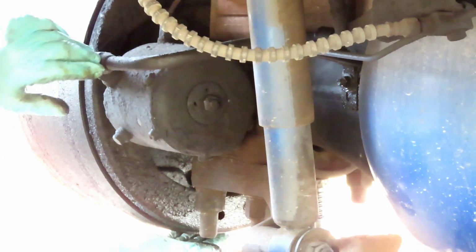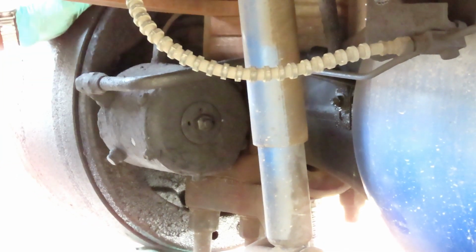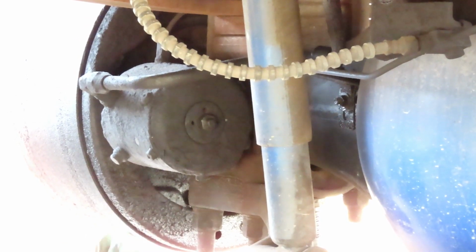These systems, even if I was to go up there and push my emergency brakes in, this will not turn. That is definitely a safety. It will not work unless the vehicle is running and the power steering, there's a power steering fluid up there. There's a different pump for this. It'll come over here and it'll release the system. So we have to do this manually. And this is what they do when they have to tow your vehicle.